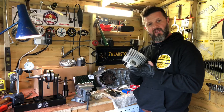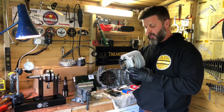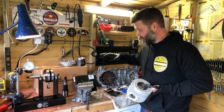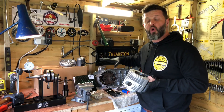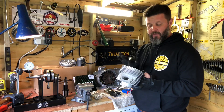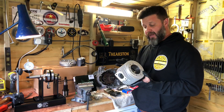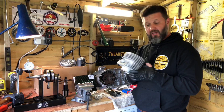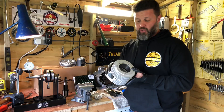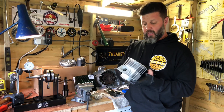That will be running in conjunction with the BGM 225 Race Tour kit. I've fitted tons of these — they're really consistent and good quality, you always know what you're going to get. They're not the highest performing kit on the market, but that's perfect here. This chap didn't want the highest performing kit — he wanted a good all-rounder which was high quality. It's an alloy cylinder with Nikasil lining, and the cylinder port arrangement lends itself to a nice lift in power well above standard, with potential to do much more if you want, but in its current trim a nice all-rounder with good miles per gallon returned with the right setup.